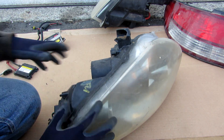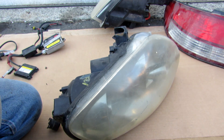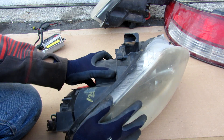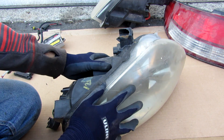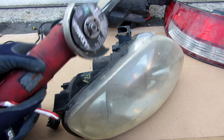In order to open a typical headlight housing you usually have to put it in the oven and bake it. The butyl seal that's around here is what's going to soften up, allowing you to separate the top lens from the rear part of the headlight that houses the reflector. However, my wife isn't going to allow me to put a headlight in the oven, so we're going to have to resort to some other means.